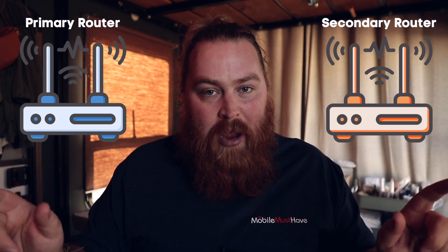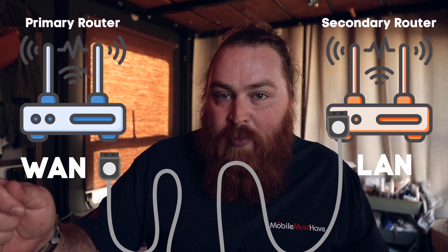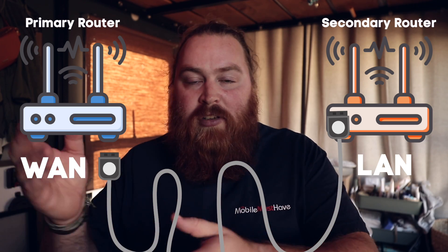Now to connect these two, everything needs to have power and antennas — there's no change there. They are going to be functioning independently, so make sure both of them can get their own power and have all the antennas they need. The key thing for connecting them is where to put the ethernet cable — you do need an ethernet cable to do Synergy Mode. We're going to take the secondary router and plug in the LAN port, and then go into the WAN port of your primary device. Basically, LAN is internet out, so we take the internet out of the secondary and it goes in as an internet source into the WAN port of our primary device. That's all we're going to do from a hardware standpoint.